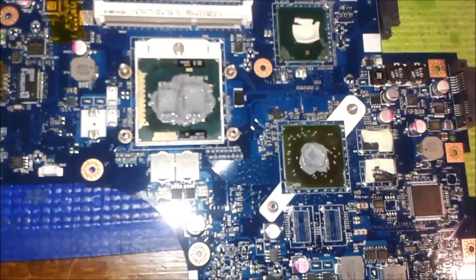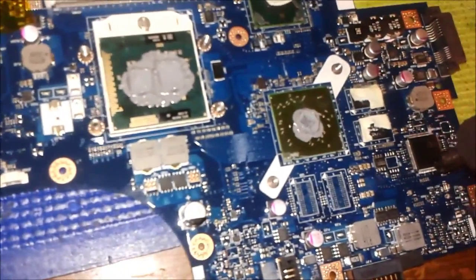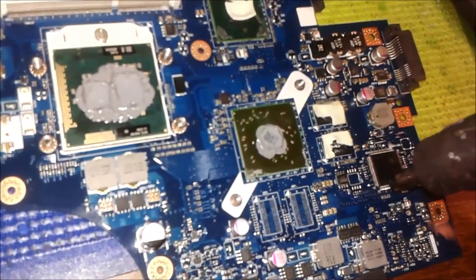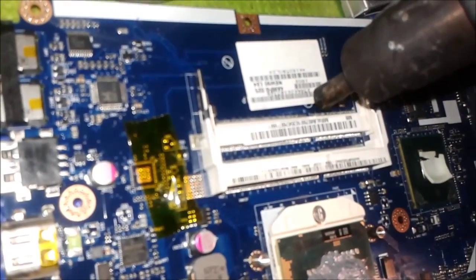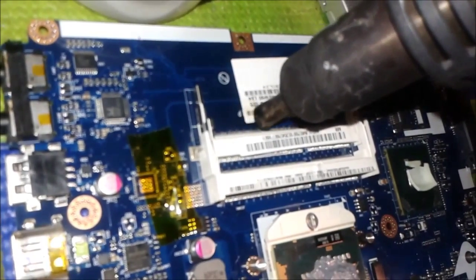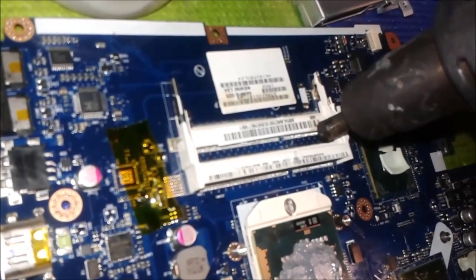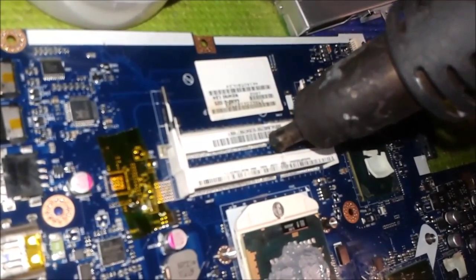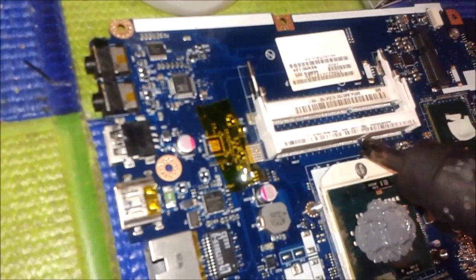I put some flux paste first and then reflow — you can see from the side on top I put paste so the shine comes. This can refresh the solder on the chip. This chip I also reflow — you can see the shine. Similarly this part I also reflow to refresh the solder properly. This is the RAM slot — I'm going to give hot air to rejoin connections. If there's any problem with these connections, this can also solve it. This is what we call motherboard service. I'll close it back and show you some other things, then we check it.